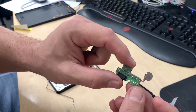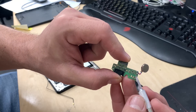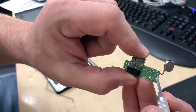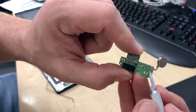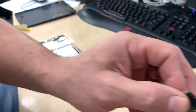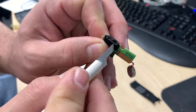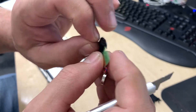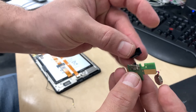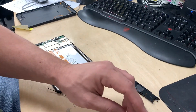What I have to do now is find this part and order it up. We will almost certainly have to solder it in, but it's not too bad — if you have even mediocre soldering skills it shouldn't be a problem. It's just two little joints, a little bit of flux, and a tiny tip for your soldering iron. There's also a gasket on here that helps keep water out — we'll pull that off and save it for the new board.